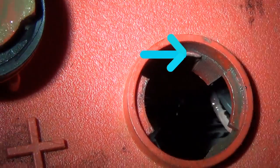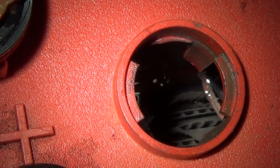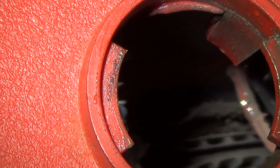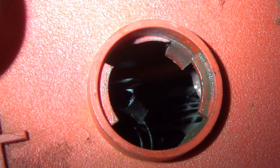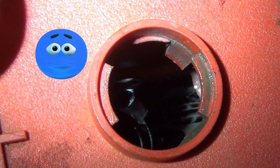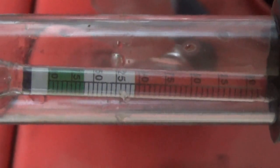See that tab right there? That red piece — the water needs to barely touch it; that's the water level indicator. See the bubbling? That's good. But I can tell the water is actually really low — wow, that's really low. That's a bad sign. I'm going to have to fill up these batteries. I won't use the acid-testing device just yet because I want the water level full first and at least a day's worth of equalizing done.